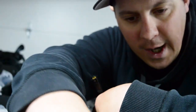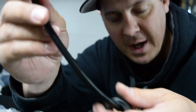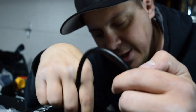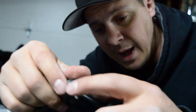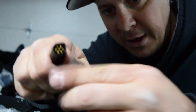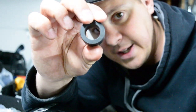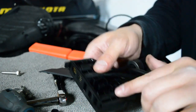The other trick: here is the transducer cable. These are ferrite rings — they're sort of magnetic rings. You put them around your transducer cable and wrap it as much as possible. This transducer cable is much thicker than the other one so I'm only able to go through once. What the ferrite ring does is take away all electrical static going around the cable from the trolling motor before sending your data to the unit, so you'll have clearer picture and less interference. Ferrite rings are very important. You want to wrap it twice — these rings are a bit too small for these cables, so I'll get bigger ones. I'll try to put a link in the video — they're about a dollar each and well worth it.